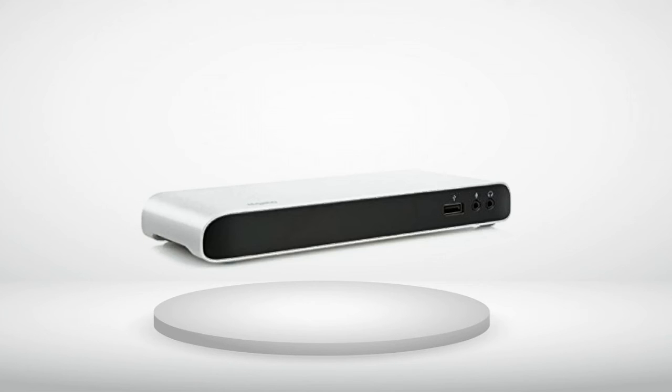Setup was super easy. You basically just plug it in. The dock seems well made and complements the look of the Mac. I love that the main connectors are on the rear panel. I can tuck it under the screen of the iMac to hide the cable clutter. The 4th USB 3 jack on the front panel is handy for plugging in thumb drives. I did some quick speed tests with 3 different USB 3 drives and was very pleased to see sustained read and write speeds of around 175 MB/s, copying to and from the internal SSD of the iMac. This is dramatically faster than the built-in USB ports, as I expected, and makes it almost seem like a new computer. It's great.